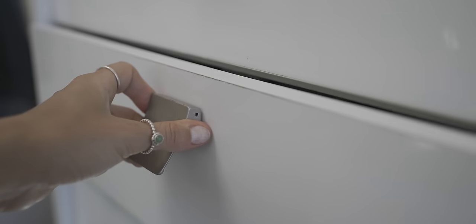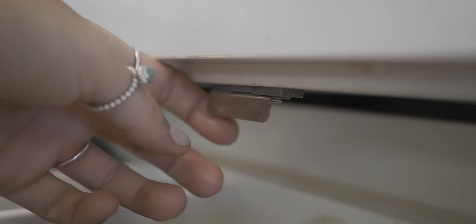Other things that have broken: the latches on the drawers. The plastic fastening clips inside were quite small when we first got the van. Whether it was user error or just going over corrugations, we'd come in and find drawers fully open with cutlery everywhere. Coromel replaced them all with metal latches — no problem since. If you're building or customising your own van, just get the metal ones to start. The outside latches are nice sturdy metal, but internally they only seem to do the metal swap when the plastic ones break, which is a bit frustrating. Just go through and replace them all with metal latches from the start.